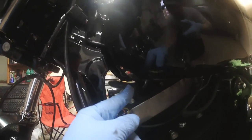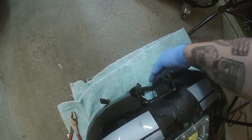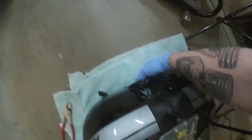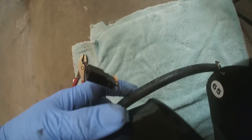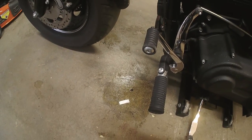That line is out of the way. Now an assistant would be amazing for this process right here — I don't have one so I'm going to have to put down the camera. Quickly unhook this line, lift the tank up above the frame and quickly pop this line back on. This is why you want your tank really low because you're going to lose fuel. I kind of reached over the bike and got my hand on this fuel line, then with my other hand I reached under and as I unhooked the fuel line I put my finger over the nipple, quickly pulled the tank up, and then used my other hand to pop that hose back on. I lost like a couple tablespoons of fuel — not bad.